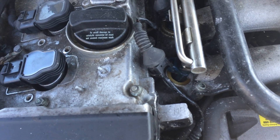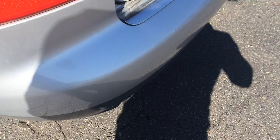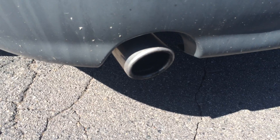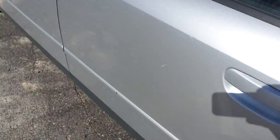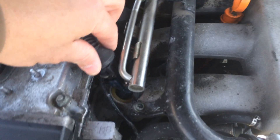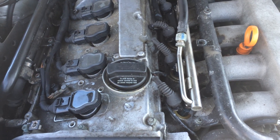And you can see which cylinder by the shaking of the motor and also by the misfiring cylinder. You can see how it has a very specific pulse to it, and basically what that is meaning is that this cylinder has a misfire. Because when you plug that back in, that misfire goes away, and the exhaust runs without any bumbles or anything.